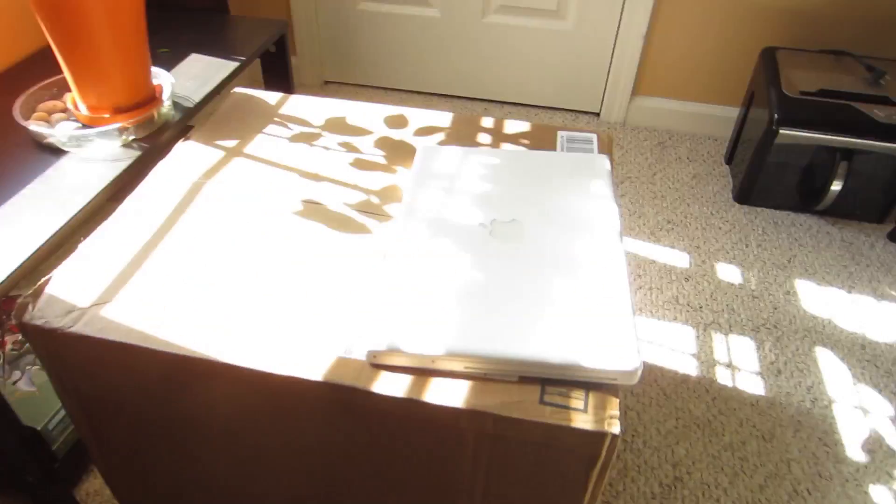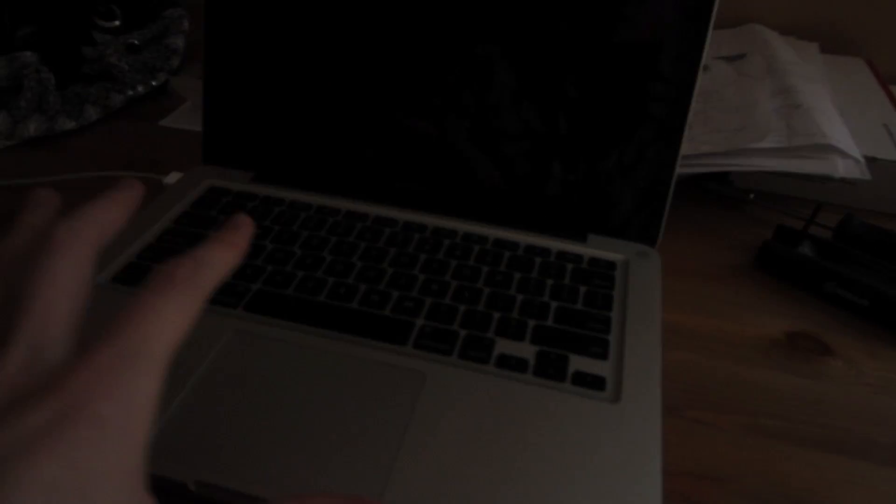Alright, so I got the computers put back together. It was pretty easy, except for the fact that the hard drive enclosure on the original MacBook took a T9 Torx and the one on the MacBook Pro took a T6. I didn't have a T6, so I had to go buy one. But no matter — we got everything back together. So there's the MacBook, which is a piece of cake, and the MacBook Pro, which is a little more difficult but still manageable.